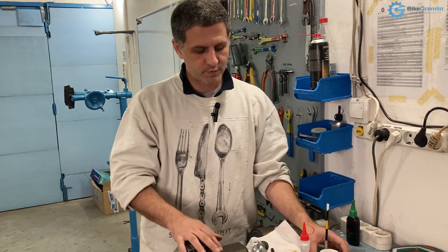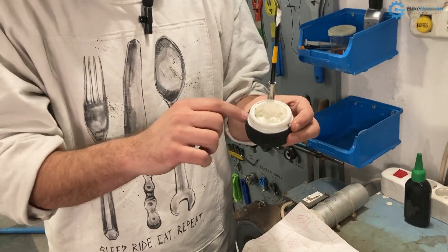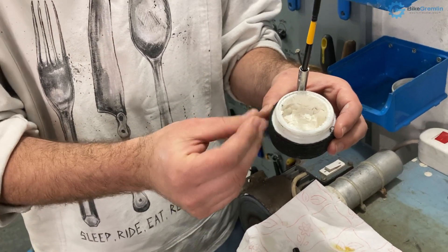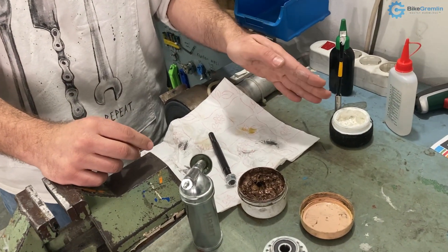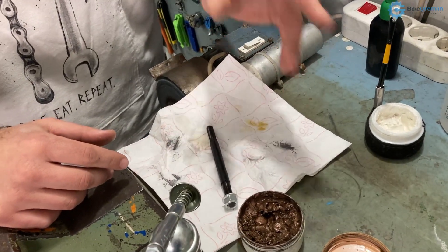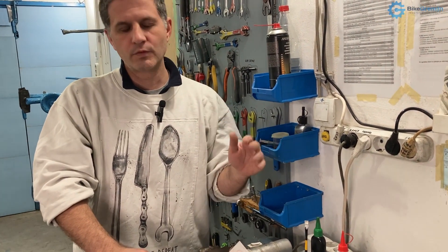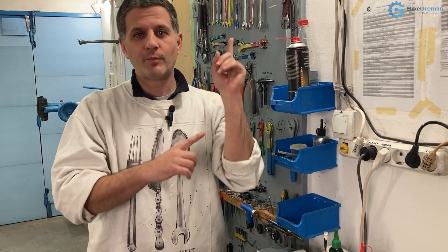There are different types of mounting and anti-seize pastes. This one is based on kaolin — a sort of clay — and titanium oxide. It's white and very easy to wipe on and wipe off, and it looks nice because it's white. That's why I prefer it. Other properties are not really important when talking about bicycles, since we don't face huge amounts of torque, pressure, or temperature. So whichever mounting paste you like is generally good as long as it's of good quality. I also have a detailed article about mounting paste — I'll make it pop up in the top right corner.